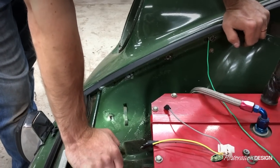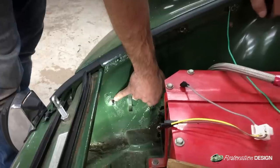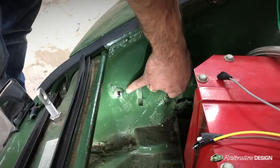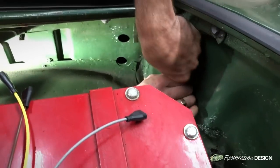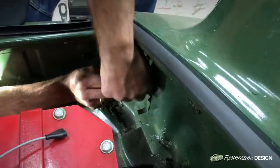To ensure good current flow for our wiring harness we have to check all our grounding points and make sure they are clean of any corrosion or paint. In this case we have a little bit of corrosion and paint. We'll take some emery paper and scuff this surface here, as on the other side, and once we've done that we're going to coat it in dielectric grease to ensure we have good continuity through the life of the harness.